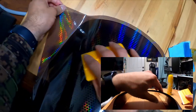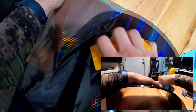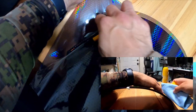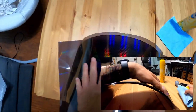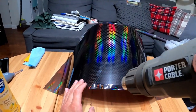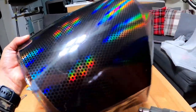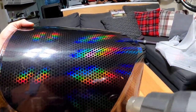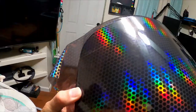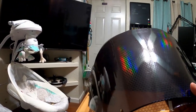As you can see, I am having some air bubbles. You just pull that up and then reapply it again, or you can use the heat gun as well. I'll use the heat gun in a bit as you guys are going to see. And then at the bottom right you'll see that I started using a paper towel just to not scratch the vinyl — it'd be a good idea to do that from the get-go. I started applying some heat on it. I'm not an expert at this. I started using the heat gun because that's what I did the first time, and I just like the way it kind of curls around the edge and stretches a little bit, making it easier to file it off from the edge.